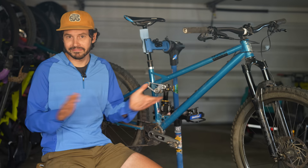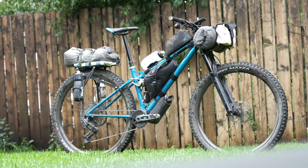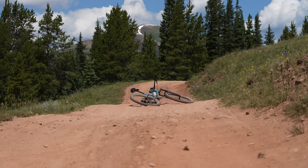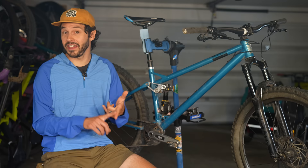Because the bike performs so well, I really wouldn't change too much. But if I'm being picky, I would raise that top tube so it doesn't slope as much, giving a little more front triangle space. I also wouldn't mind a shorter front center — steepen that head tube angle and shorten the reach a little. Fortunately, Reeb actually offers custom head tube angles, axle-to-crown measurements, and reach lengths for a limited time, which is pretty neat.